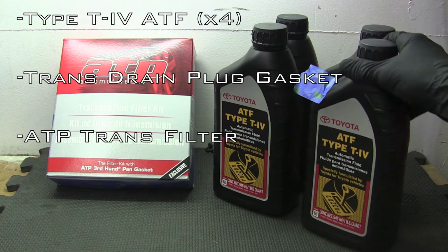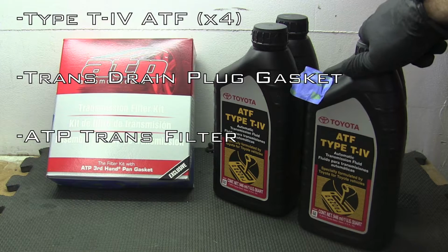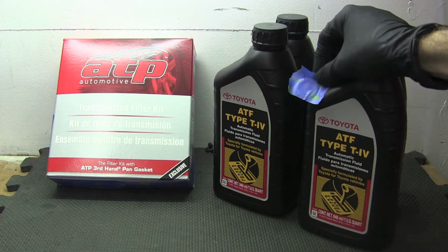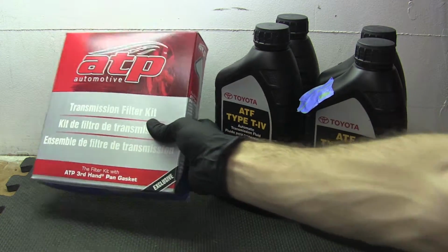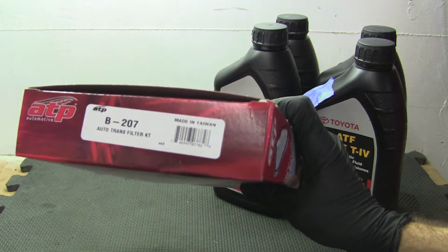The fluid I'm using is Toyota Type T4. Since I'm doing just a simple drain and fill, the capacity is just over 3 quarts, so you'll need 4 quarts total, and also a new transmission drain bolt gasket. And then the transmission filter from ATP. I'll put a part number in the description of the video.